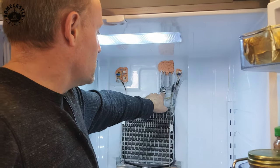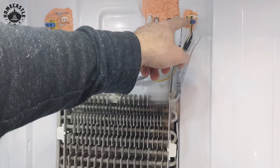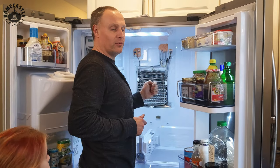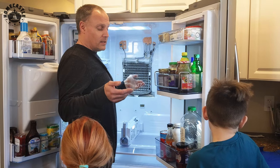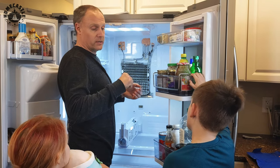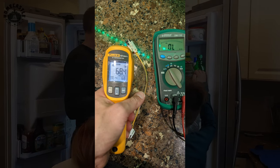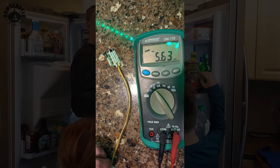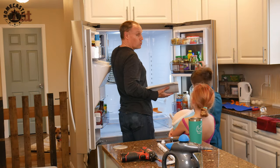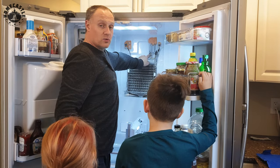There's a sensor that reads the temperature of the coil — it's a thermistor. The manual has a table showing what resistance value this should be at a given temperature. Resistance is how much a circuit wants to stop current from flowing — it changes with temperature on this device. Set a multimeter to ohms and test the resistance. At 67 degrees ambient, look up the table in the manual to confirm the sensor is reporting correct values to the computer. If you see what I'm describing, instead of locating the sensor here, relocate it to here — this will force the defrost circuit to run longer.